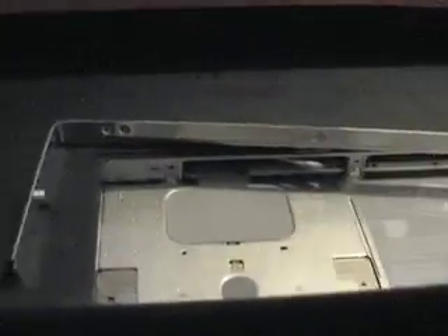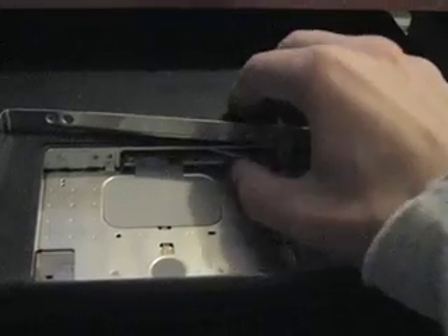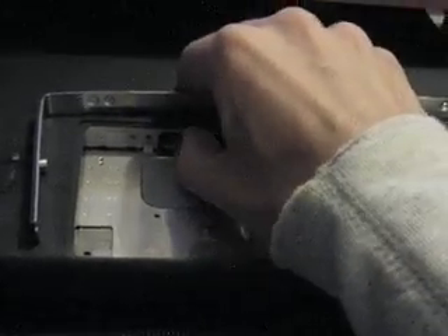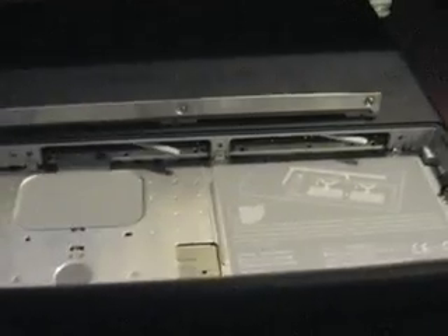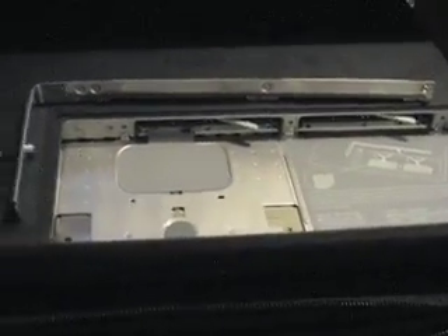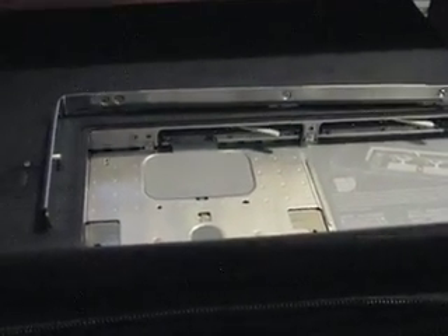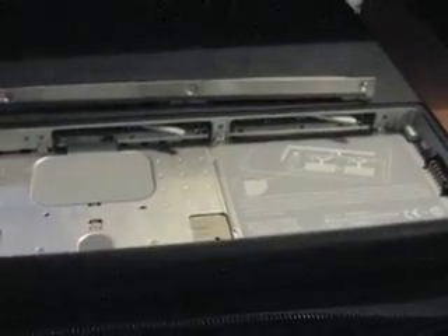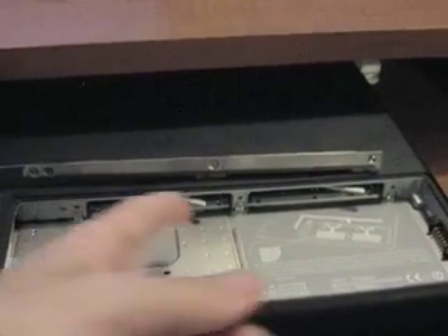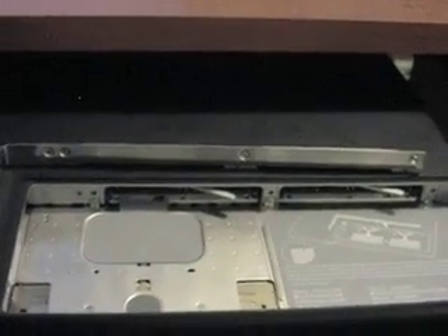The little lever isn't going to go back in when the RAM is all the way in — that lever is just to let them slide out. Take them both out, put the new ones in, and make sure they're pushed in all the way. They're not going to click, but you'll feel when they're slid into place. Then take the L bracket, put it back in, pop the battery in, and you're done. When you turn on your MacBook, it should recognize the new RAM. If the sleep light just illuminates and you don't get the Apple startup tone, it's not seated right — pull it out, put it back in, and make sure all the pins are pushed in nice and tight.